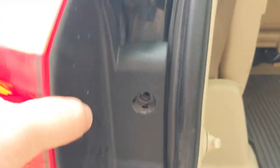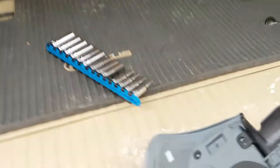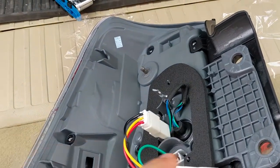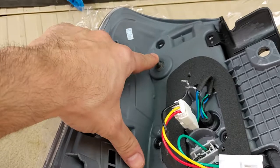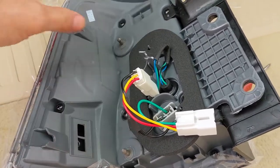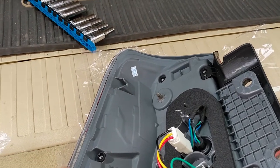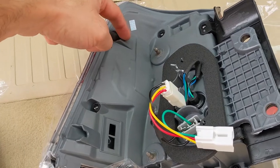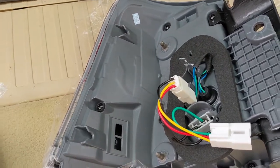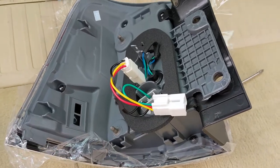Let's see what direction I want to pull this. Looking at the back of the new one — these two are off now. We've got these two push pins and then these two, so if I pull outwards, these will pull out and these will pull away from whatever those clips are. The same with these two, so we'll pull towards the back of the vehicle.